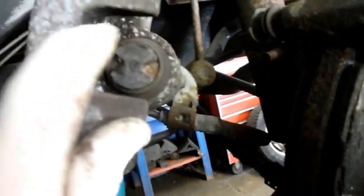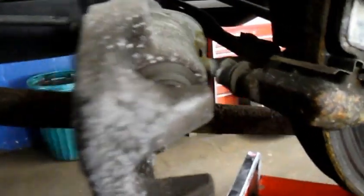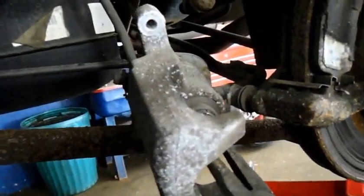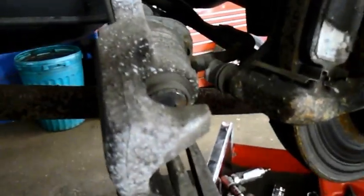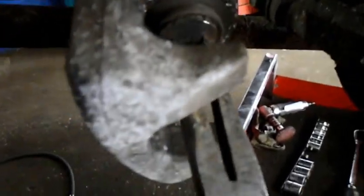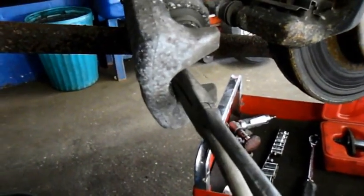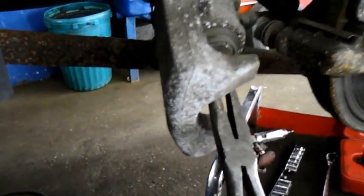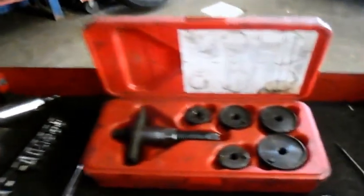You see these little slots right here? Those are the slots that the tool has to fit into. Now if you don't have the tool, I've done it myself too — you can take a pair of needle nose pliers, put them in here like this, and you can rotate the piston and push it in at the same time. You'll have to turn it clockwise to get it to turn back in. It is a pain in the rear end — you can do it if you had to, but you're going to need two hands. I'm not going to — I'm going to use this tool right here.